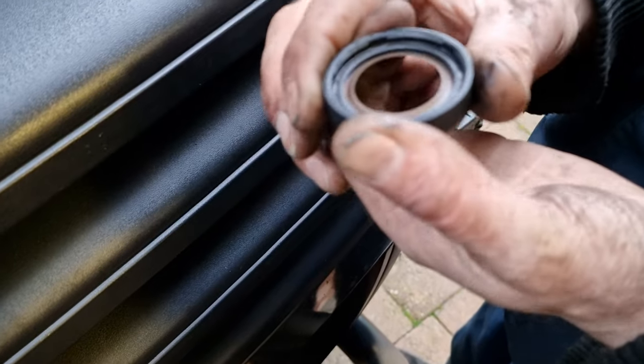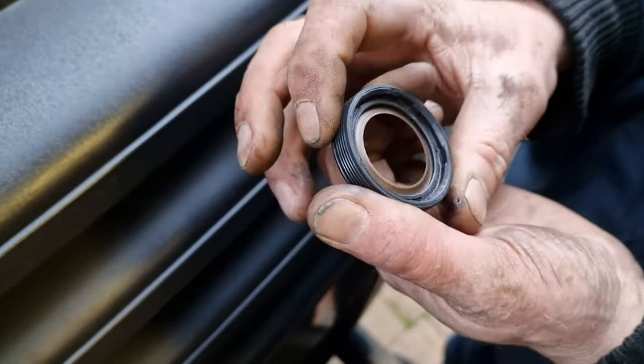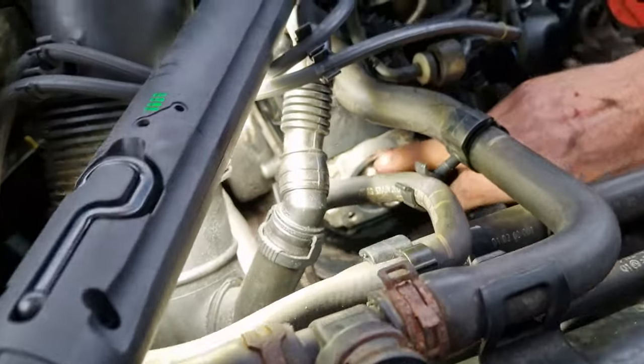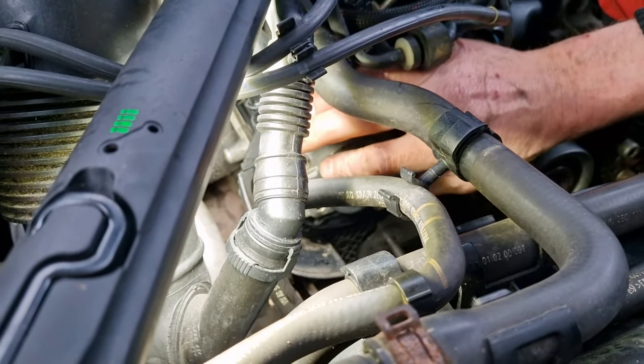All right, yeah. No guide cone. Is that just to get it over that little lip? Yeah, I can see the lip, because you don't want to catch them. We're having to do a bit of improvising. We're actually missing the guide cone that cups the seal and allows us to push that over the start of the camshaft. So that's what Cliff's been doing there. He's just warming up the edge of the seal, nice and slowly, just to make it slip over the end of the camshaft.